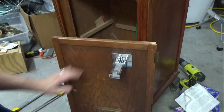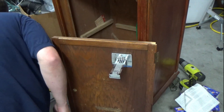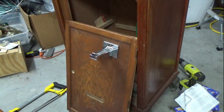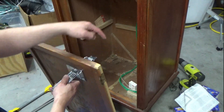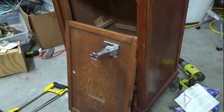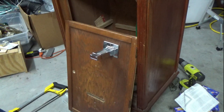That was a simpler thing to do on here. You've got to put the graphic back on the door, reassemble it, the marquee goes around it. That's it for now — we'll be doing a little more stuff with the cabinet, got to clean it out. I need to do a continuity check on the wiring from the pigtail that goes to all the light bulbs to make sure they all connect correctly. And work some more on the diagnostics with the electrical. Thanks for watching — I'll see you in a little bit.